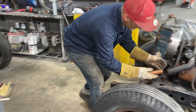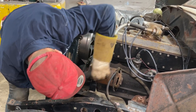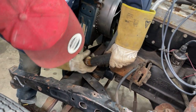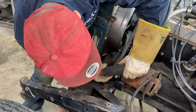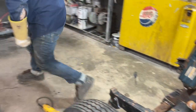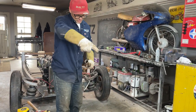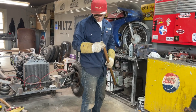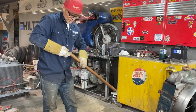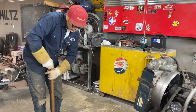Alrighty, I'm gonna shove this in here. I'm gonna solder another elbow. Made it a little long, that's fine though. So I have to go across there, so we're gonna have to do another one like we did that one. I did not get the elbows to fit this stuff because it makes it hard for the pipe to go on. All right, this is looking pretty good. So I'm gonna solder another elbow on this piece. We'll run it across.